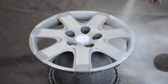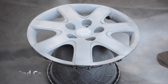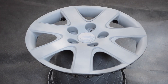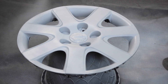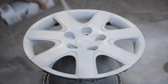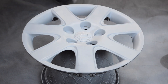Our first coat of primer paint should be a light and even coat. While spray painting, you should always start spraying before the object and finish after it to help provide that even coat. You're going to want to wait about five minutes before applying each coat, and it's good to spray from different angles to ensure maximum coverage. The third coat should also be light and sprayed from different angles — with spray paint you get the best results from multiple light coats. The fourth and final coat of primer is a little heavier and more focused, running up and down each spoke as well as around the outside rim for maximum coverage. Remember to paint in a well-ventilated area and wear a face mask for protection. You're going to want to wait at least an hour before the next coat of paint.